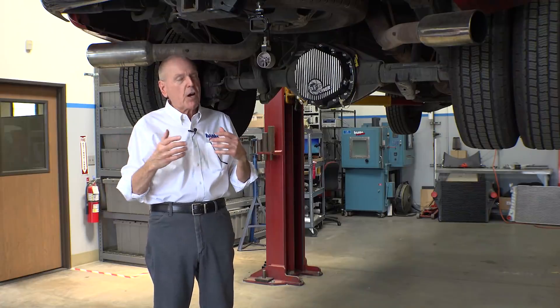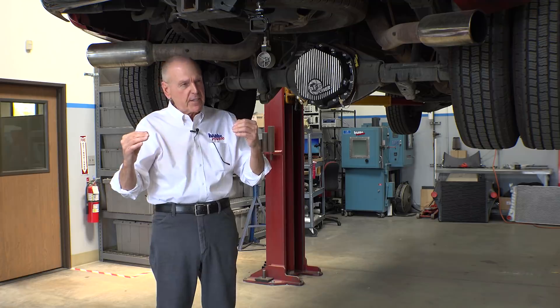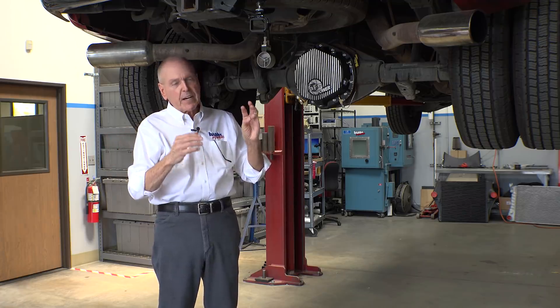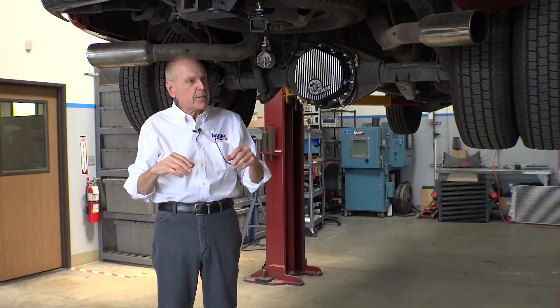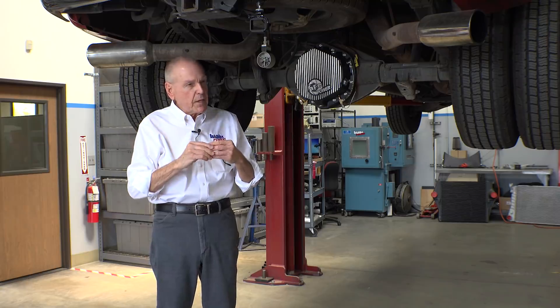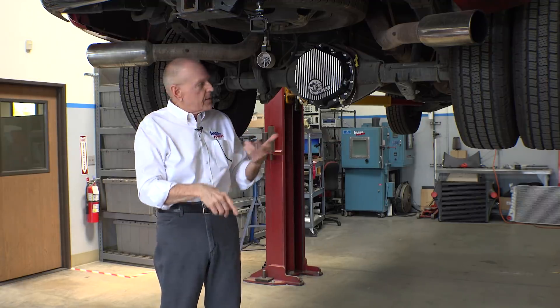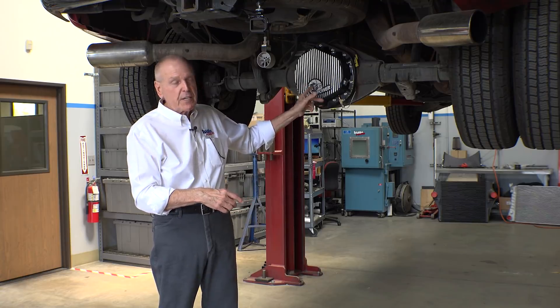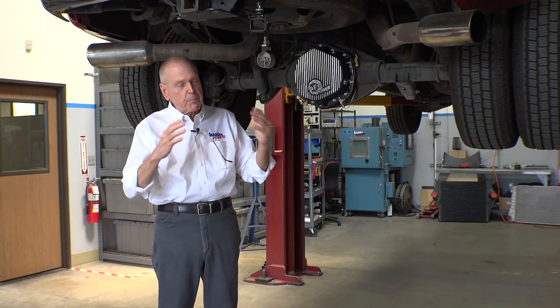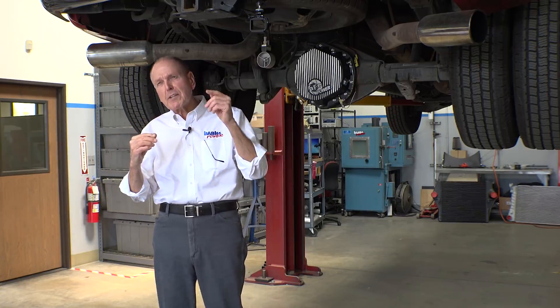It's hard to find data about where the peak temperature should be, but we're running 75W90 synthetic. Synthetics vary quite a bit, so we did a lot of research — put Eric Rider on that — and he came back with performance data for various makes of lubricant. We chose one make and we'll be using it for all the testing, so that's fixed. The test vehicle is this Dodge, and next will be a GM product. At the end of the day, you want the minimum lubricant temperature to get beyond the dew point temperature on that day, which ensures water condensates out of the axle housing through the vent.